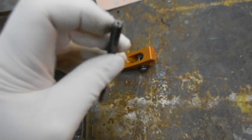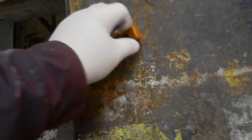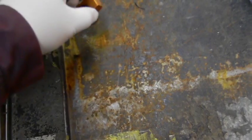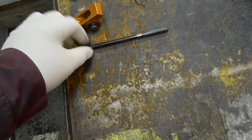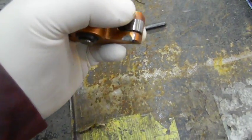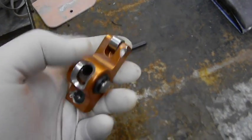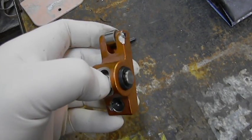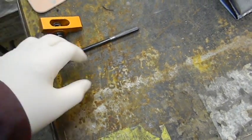I don't care what order they're in, because when you think about it, half of the surfaces are worn and they're going on new lifters. The other half are just going into there. Some people will keep them in the exact order. I don't think the exact order is required. Even the tips, I looked at every one of those valves before you got the engine, and the tip is perfectly flat. There's no grooves, no wear, nothing. So I don't see putting them in a different location being a problem. So with that, that's going to help out a lot.